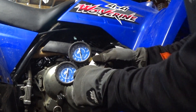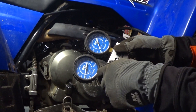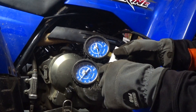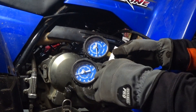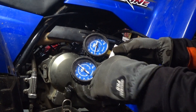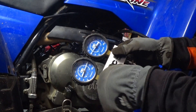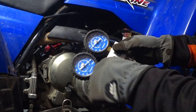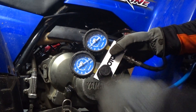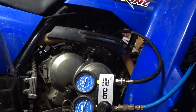You want to turn this in slow so that it doesn't kick back. I'm just watching for pressure loss. We want to go up to 100 PSI — it should be about 90 reading on the left gauge. We're at 95 PSI and there's air. Where is it coming from? The air box.